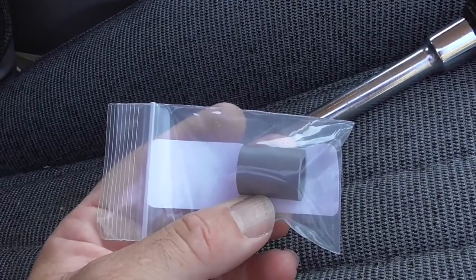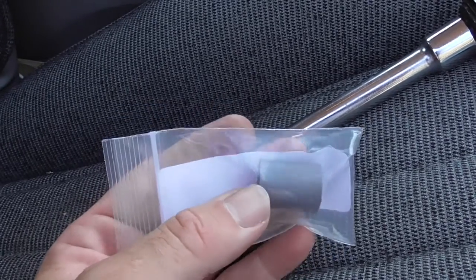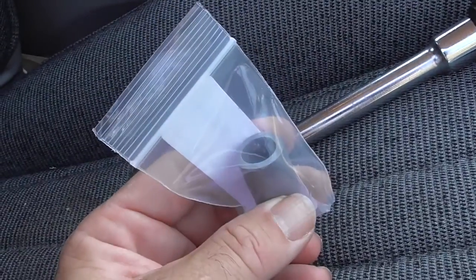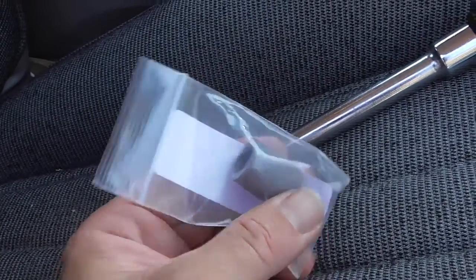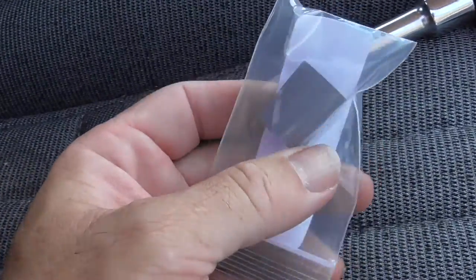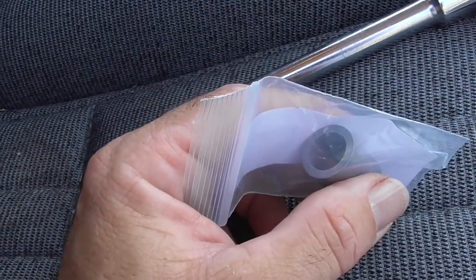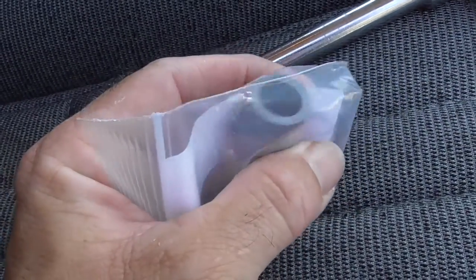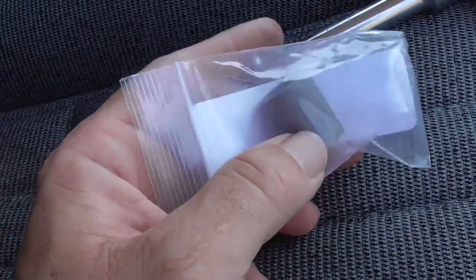I just did a video on how to put these bushings on the front doors of the Mustang, but you can do this on any vehicle that is having a problem latching. Some people use 1/2-inch plastic tubing, which is ridiculous, because if you're going to spend the time to do this, why use a piece of clear plastic that's going to fall apart and break sooner or later? It might not, but why not spend the money and at least do it the right way? You can buy a whole new striker plate for your hatchback for about 38 bucks that comes with this washer, but you shouldn't need the whole striker plate, or the striker bolt. You just need the bushing.